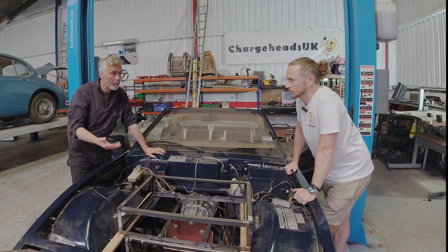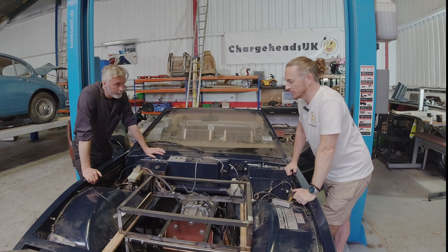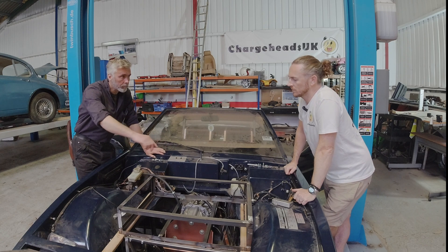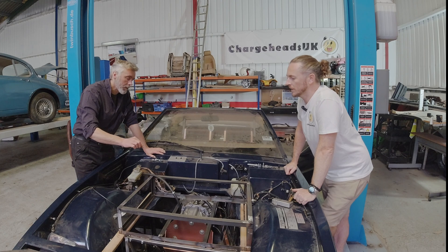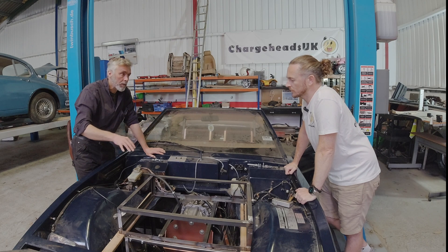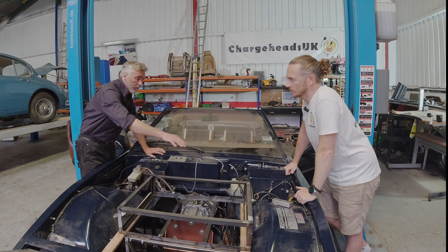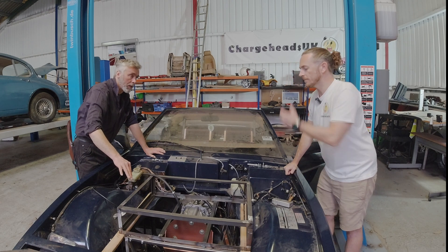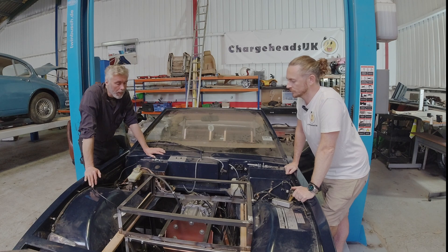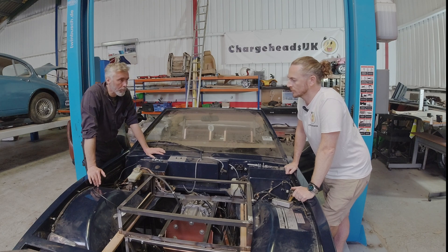We also use other materials inside the battery box, both to insulate it and to give it a degree of fire protection. It's going to be water cooled in there. The cooling works like underfloor heating — there's a little labyrinth of channels that go through aluminium plates. They all link together and then we have a cooling pump. We have a number of temperature sensors in each one of the modules, so we'll monitor the temperature at loads of different points all throughout the battery box, because it's very easy to have a cold spot in one place and a hot spot in another. If we only measure it in one spot, we might think the battery is fine, but that battery could actually be overheating.